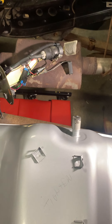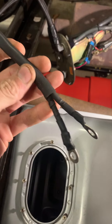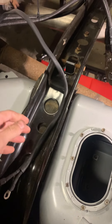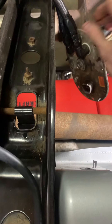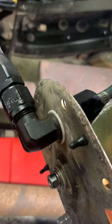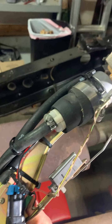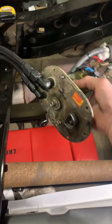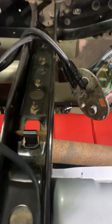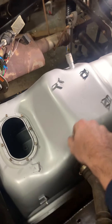I can show you a little more about the fuel system. I ran 8-gauge wire to ring terminals all the way from a relay under the hood that the Haltech fires off. I got my Vibrant fittings in my stock hanger — I drilled it out, put bulkhead fittings in, with adapters that go down to 5/16ths. I got my Hellcat 525 pump in there.